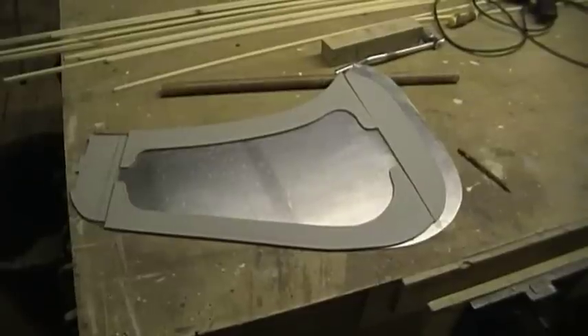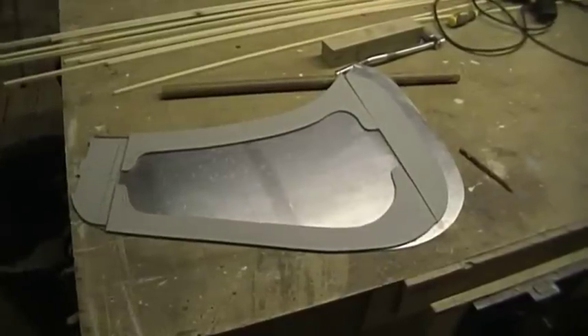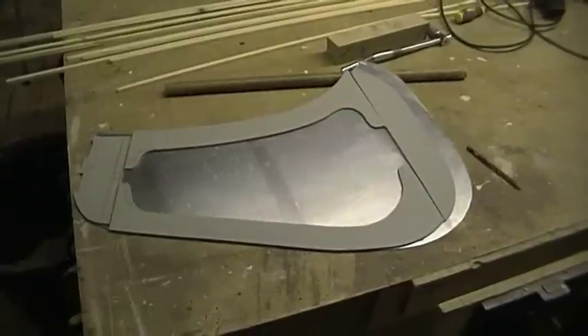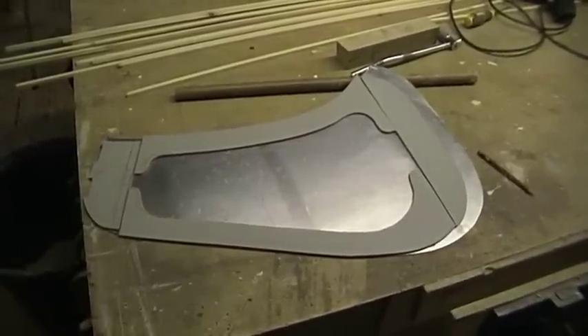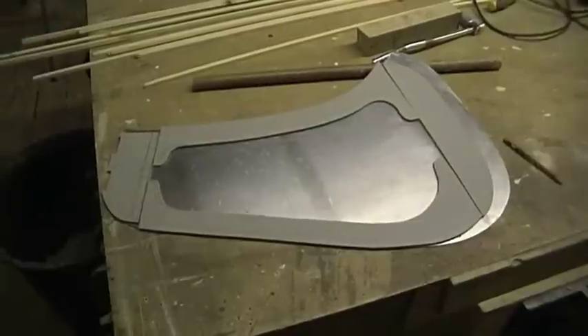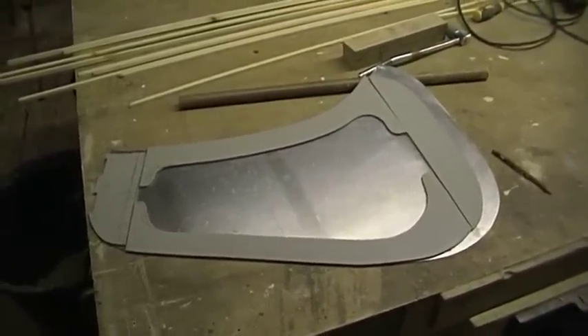I've done butt joints and this is to allow the rails and the verticals just to rotate in order for me to twist the components into the right shape of the door. What I'm actually going to do is, once the door's bolted to the actual body, twist all the bits so the body follows the contours of the frame and then carve the door into shape after that.